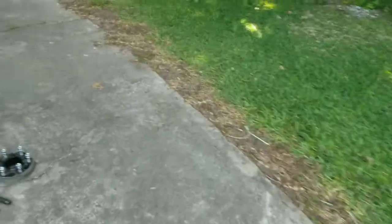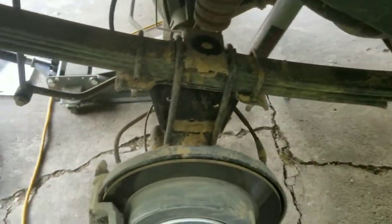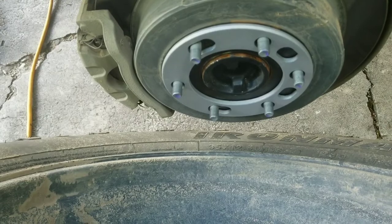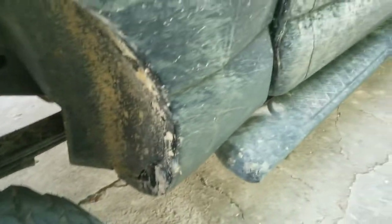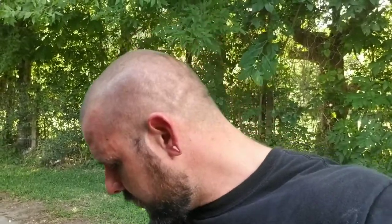So what I'm doing now is pulling off those inch-and-a-half spacers and putting these quarter-inch ring spacers on instead. I originally thought my issue was that my studs coming out of the hub weren't long enough to catch thread — that's why I thought I couldn't use the quarter-inch spacer before.